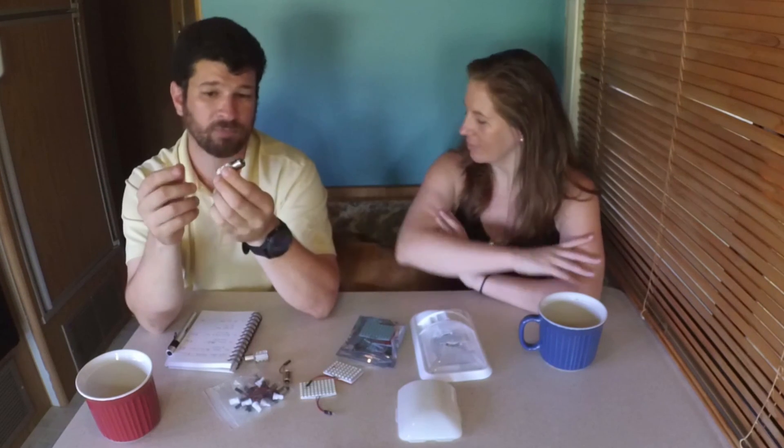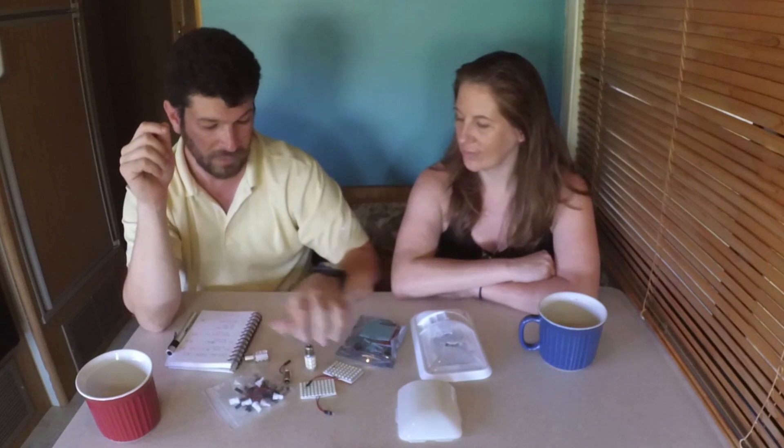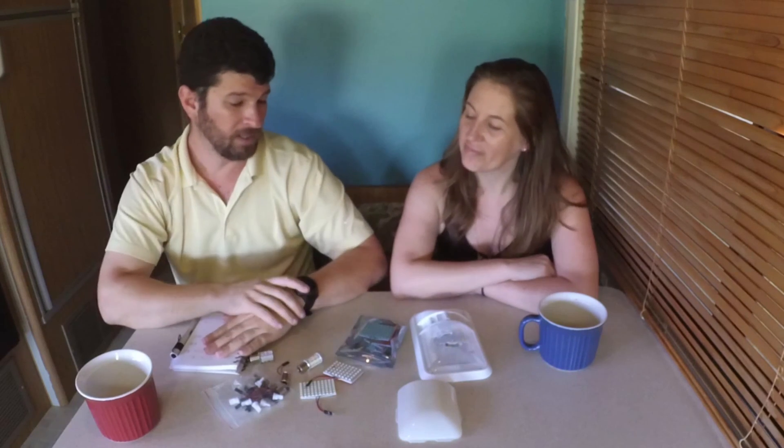For the outside lighting like the porch light, I wanted LEDs there as well, so I switched to a different style bulb for that and it's working okay. We have one out there that's actually twice the length, also working okay - we'll see how long it lasts. The side lights in Barry are a different bulb entirely. Part of the reason I bought the single-electrode bulb was that those are in a light shade, so I figured the panel wouldn't work and the bulb would. But those actually use a dual-pole instead of single-pole, so I've got the wrong LED for those.